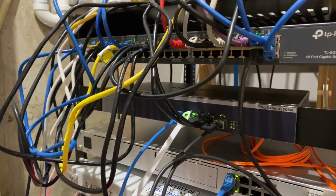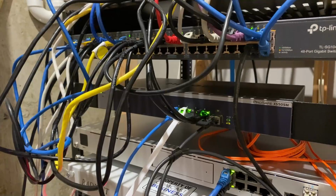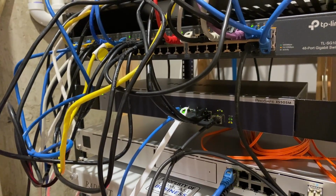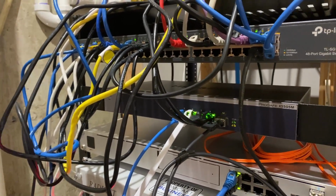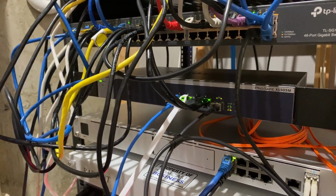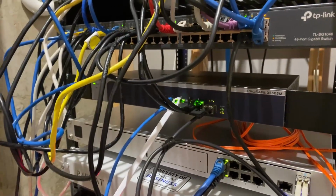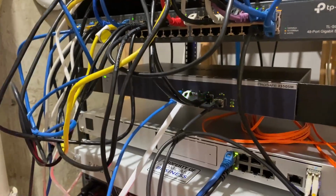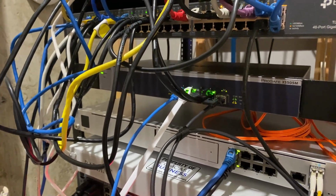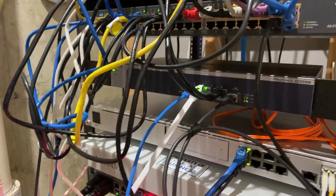The computer that we're on right now is connected via 10 gigabits with that card I put in, so it can make use of the full speed. And then this white cable here is going upstairs, and I have a 10 gig switch up there. Then I have my gaming computer on a 10 gig card, and a 10 gig Thunderbolt adapter for my Mac, so that's connected up to use the full speed. And then this cable goes to a little sitting room on the other side of the house, and there I've got a 2.5 gig switch. I actually run right now a 30-foot cable to my laptop in the kitchen off of this leg so I can upload at full speed.